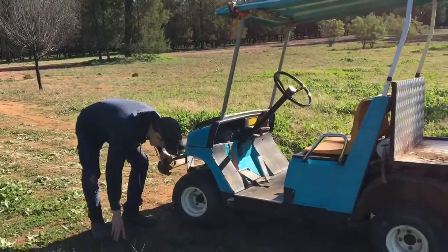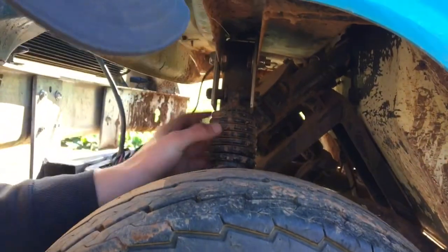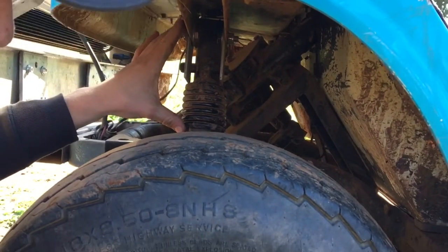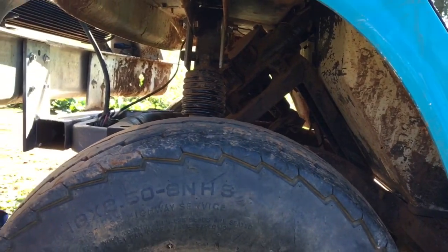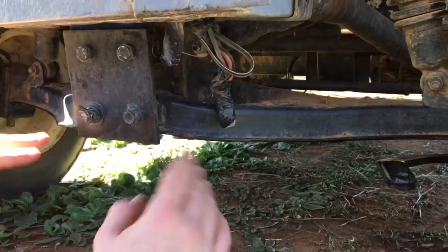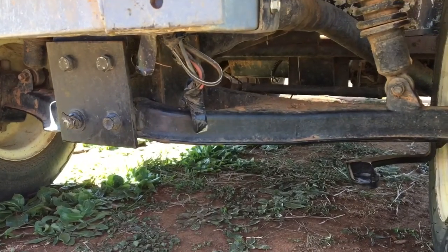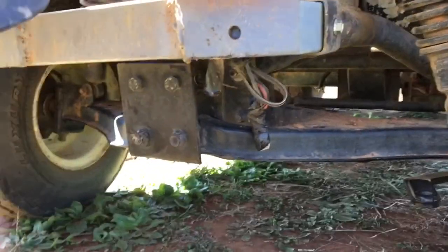With the suspension, I got some plates from Bunnings and made them up so it's a two-inch lift on this — it doesn't look like two inches. I'm thinking of doing a four-inch lift so it'd be double, a lot higher off the ground. It's exactly the same on the back, but with the front I had to drop the actual arms down and make up some plates to drop the whole arm down — if I didn't, the wheels would be on an angle. It makes it more comfortable to ride. I'm still thinking of the four-inch option.